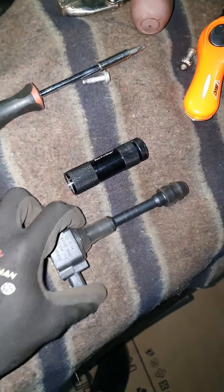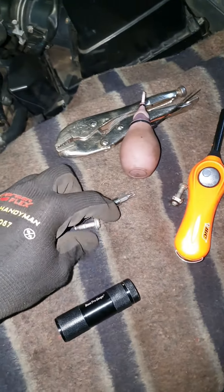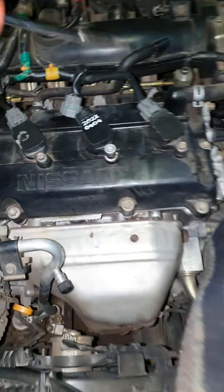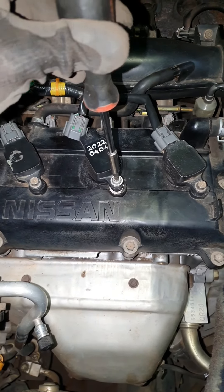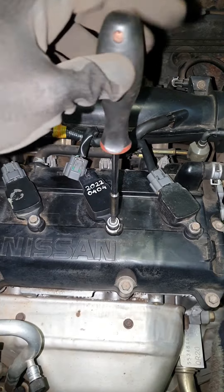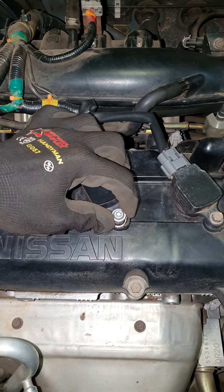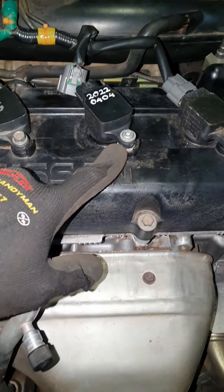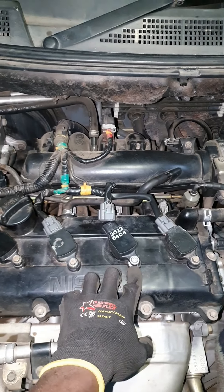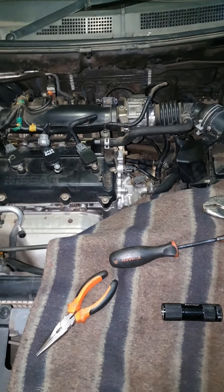It's pretty solid — not moving around, melted right in there — so that should hold it pretty okay. By the way, this torx has some sort of lip that prevents you from tightening it all the way down; after the threads, that lip will prevent you from over-tightening. So we take our T30 torx and the torx driver — remember what I said about things being wrist tight, you don't need much force with these. Just enough to let it sit in and be nice. We're going to firmly secure it after checking a few things to make sure it's correctly seated — plug it in and we should be good. This whole video was just about repairing one single threaded piece, and that's what we've done today. Till the next one — for real now, this one ends here. Peace.